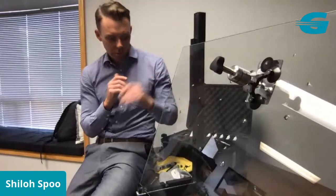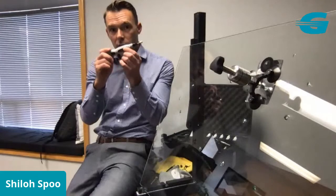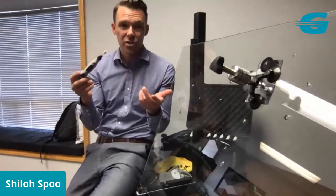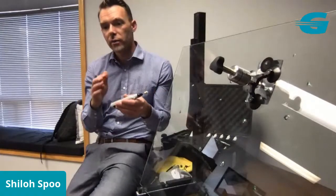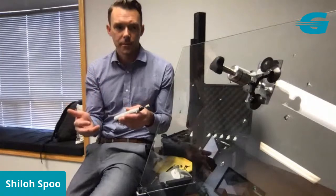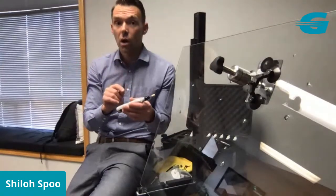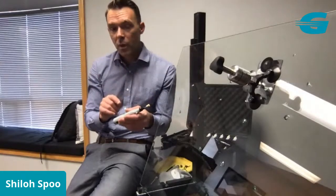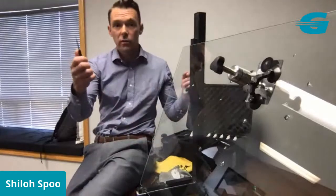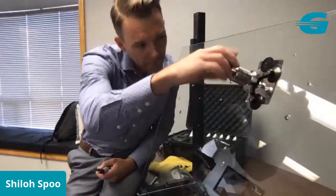Once this second vacuum step is set up, I have my little polishing tool set up, and we also call it sort of like a massaging tool. Now, a lot of you out there are probably repairing windshields right now in warm climates. And so I'm going to show you a couple of techniques you can use with this new tool to avoid probing or to limit the amount of probing. Now, when we talk about probing, we're talking about using one of these guys.